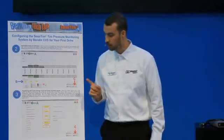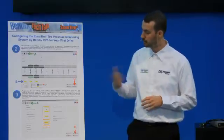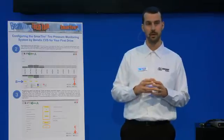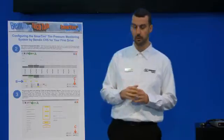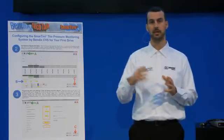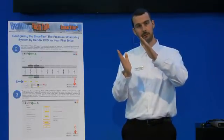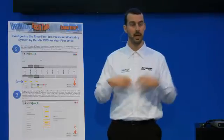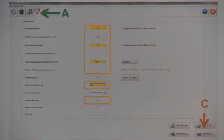From a dealer perspective, this is an important value to report to your customer because they may want larger or smaller percentages — this will ultimately determine how soon warnings come on. 15% is a very reasonable number for that first alert; it won't come on too often, but when it does it's definitely time to air up the tires. Just below that, there's a check mark: when checked, it tells the system that you want the first alert temperature compensated, meaning for this percentage the system takes into account the rise and fall in temperature as the tire heats up and cools down while driving.